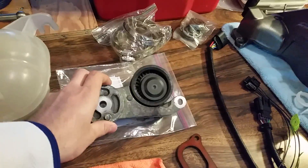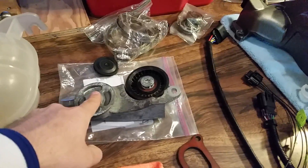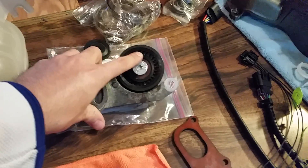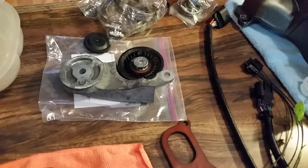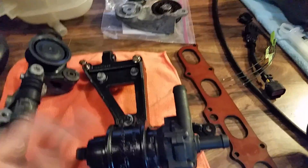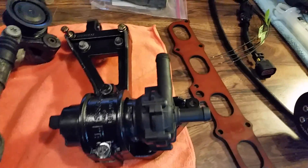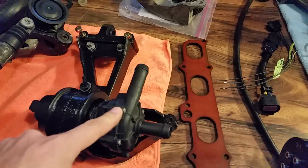You're going to need the idler pulley. Unfortunately this pulley is only sold with the bracket at the dealership, so I cross-referenced an AC Delco pulley that's the exact same size, dimensions, and similar groove pattern. I'll be trying that out. For the intercooler and intercooler pump bracket - you don't need the stock bracket, but it's a good quality bracket and you can find them pretty cheap used. I tested my pump before using it.